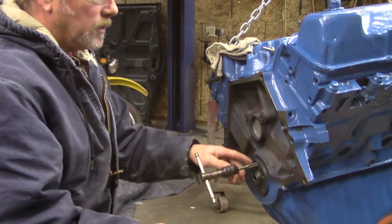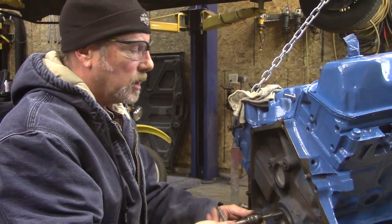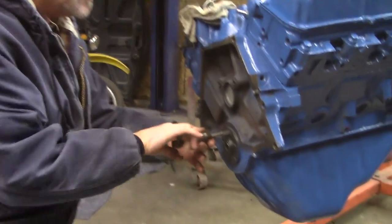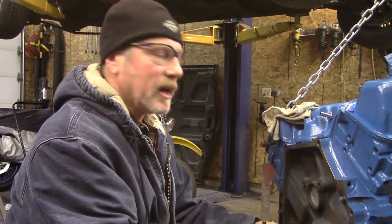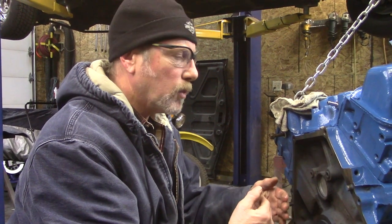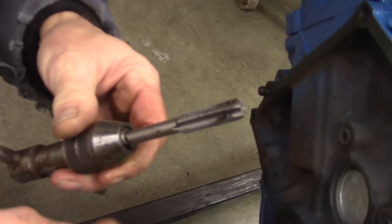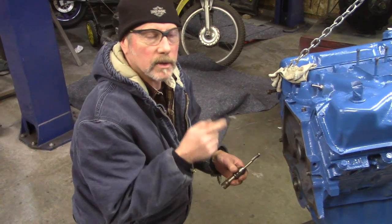Everything's been cleaned off. This is all the time-consuming stuff that people don't realize when they're paying somebody to work on their car, and hopefully they don't cut corners. All these threads have to be cleaned out so that when you do a torque you're getting the right reading — we're just getting the crud out of them. A lot of people don't have the taps. Usually all the fasteners are fine thread — there's more contact surface, more threads per inch, so it's got more holding power. In the past when people put these on, they usually used Loctite so they won't come off. That's what you're cleaning out — it's like a plastic, a liquid that when it doesn't get air it hardens up and keeps the thing from backing out.